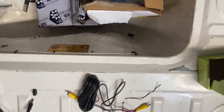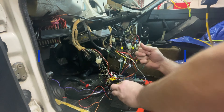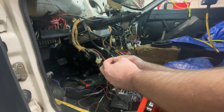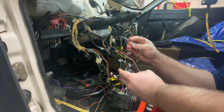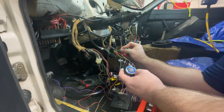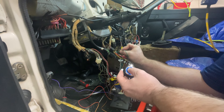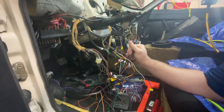I'm going to leave everything loose for the moment so I can get everything wired up and tested. Following these wonderfully written Chinese directions, I have the ignition temporarily hooked up for testing purposes. It requires the brake pedal, oil pump, and parking brake — so that's what the purple is for: parking brake to ground, oil pump and foot brake to positive. And then when I engage the brake, I can start the engine. Only problem is, it doesn't want to stop.